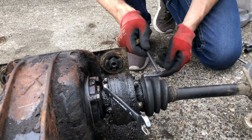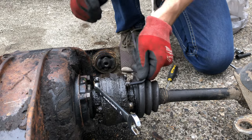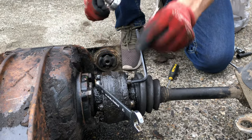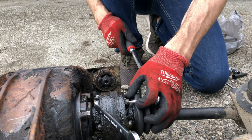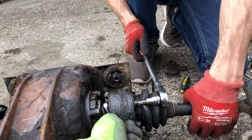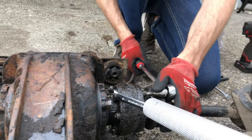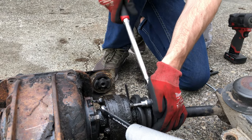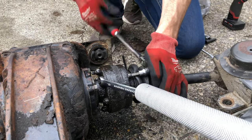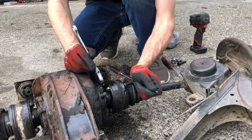Yeah, so we're trying to take off these half shafts or whatever they're called, and we've been trying to use just a 6 millimeter hex wrench, and it just was not working. They're really stuck on there, so we picked up this 3/8 socket adapter, and with the extra torque we're easily able to break it loose. Oh, hold on, let me put in the cheater bar. Okay, holding. Oh, yeah. So that's the trick. Nice. Next one. So, looks like all of them are loosened up now.